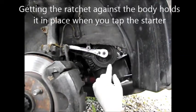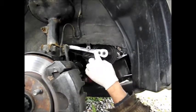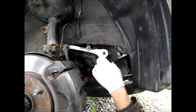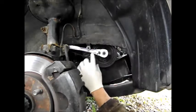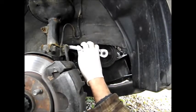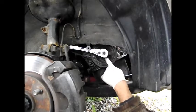I'm going to leave you watch that. What I'm going to do is just bump the starter. This is just a normal right-hand thread — it comes off like a regular bolt, it's not an opposite thread. So I just got my ratchet set to take it off. The motor's going to bump that way and it's going to break this bolt right loose.